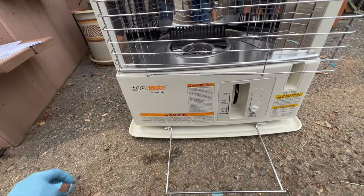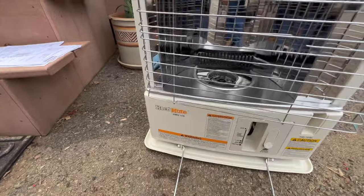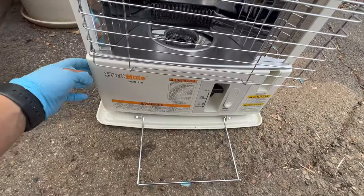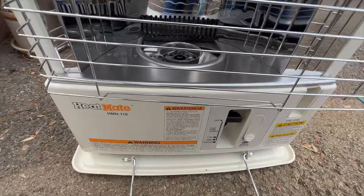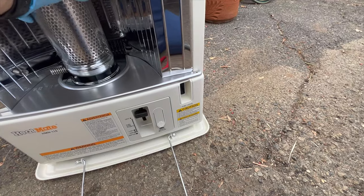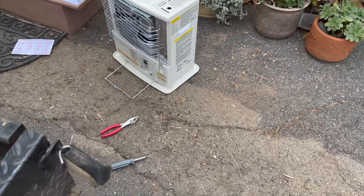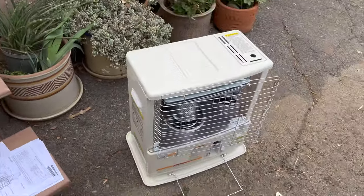Place the front panel back on, put the screws in, and reinstall the knob cover — make sure it still moves as it should. After installing the front panel, screws, and knob cover, go ahead and place the chimney back into place. Install the four batteries and that's it — that's how you replace the wick on your kerosene heater, the Heat Mate heater.